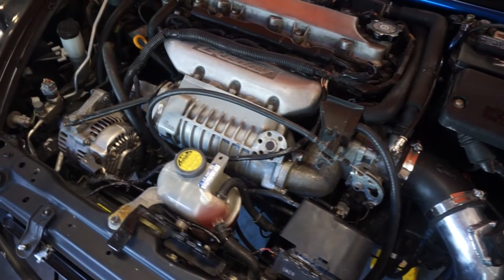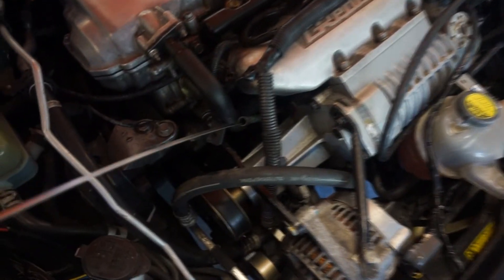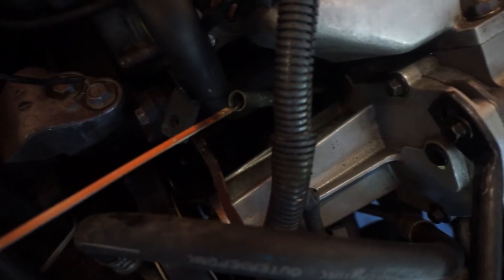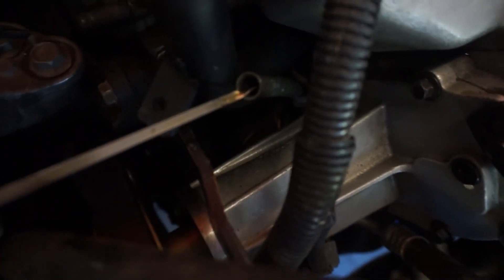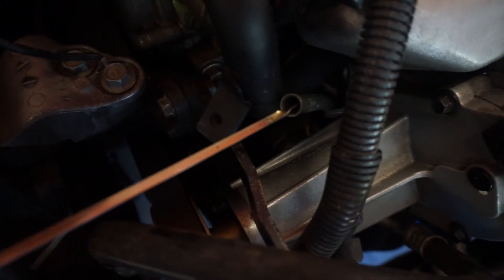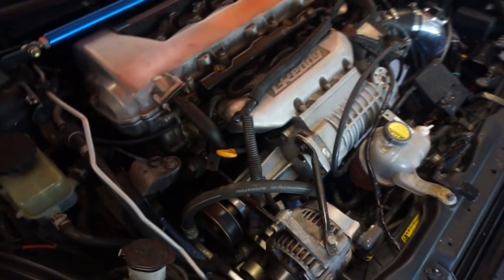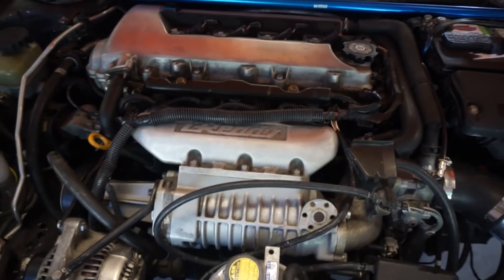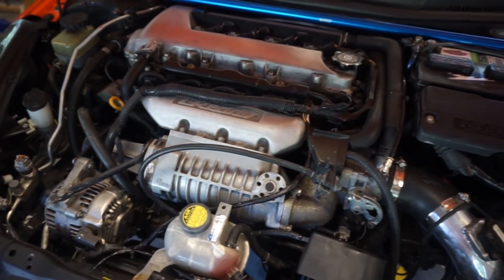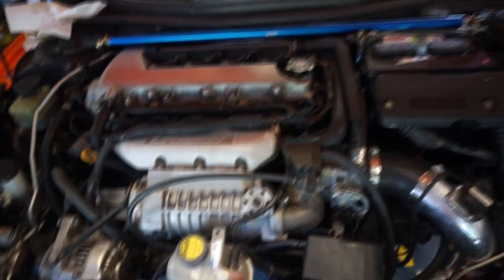We just ran the car for a little bit. We're gonna take your dipstick out, clean it off, and recheck it. We wiped it off and reinserted it — we're right over the first dot, about midway to the second dot, which is right where we need to be. That is how you change your oil on one of these cars. Everything now is just in reverse — put on your splash guards, put on your front end. Hopefully that helps you guys out. Thanks for watching, take it easy.